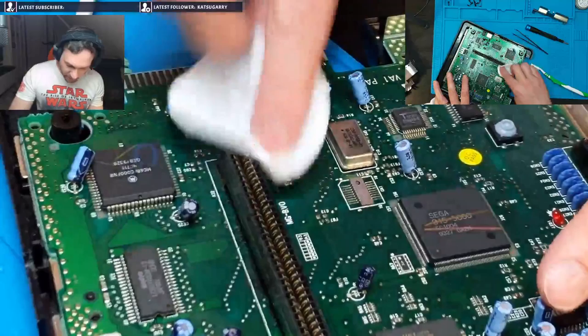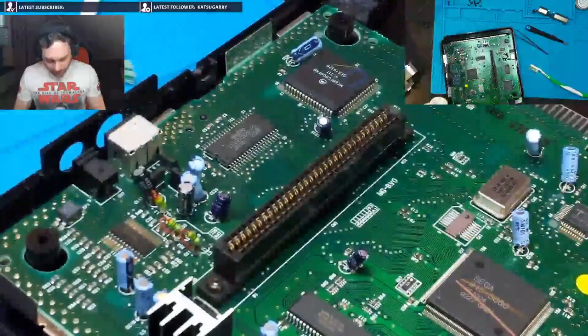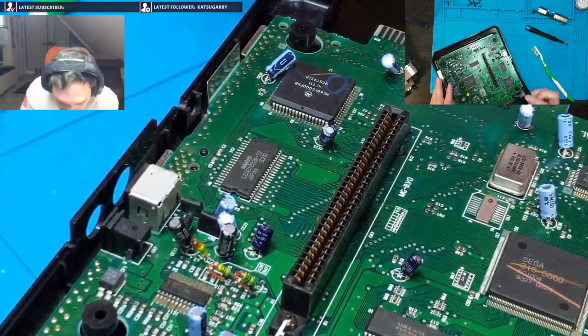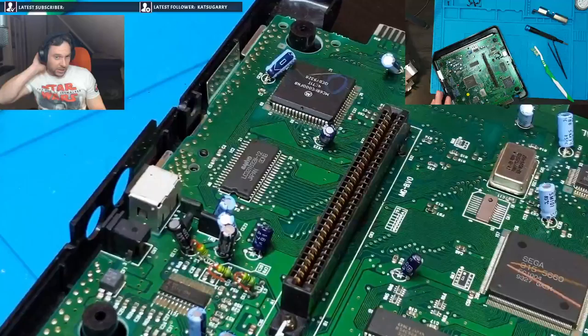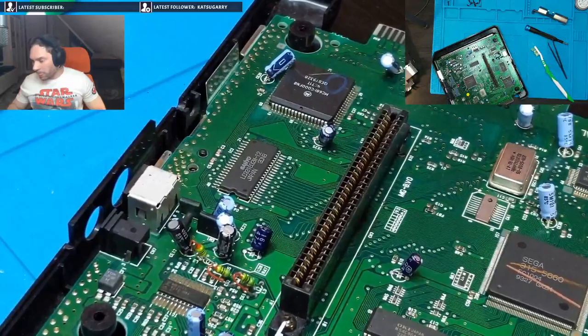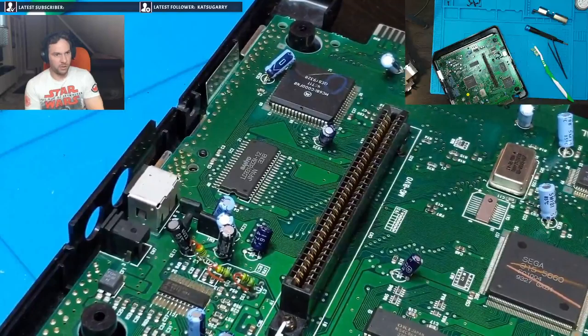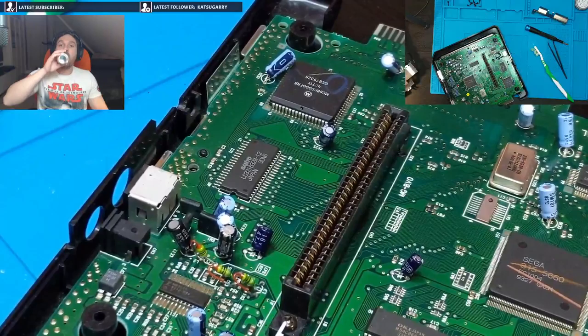It's actually working a lot better than the brushes. I think the brush is working it out. I think that's probably as clean as I can really expect it to be tonight. A credit card with a cloth wrapped around it would be ideal — I'd put that in there but I'm not prepared for that. It has to be a cotton cloth like an old t-shirt cut into ribbons. You can't use a duster or something that's too thick — it has to be something very thin, otherwise you're going to completely ruin the cartridge if you're trying to force anything big into it.